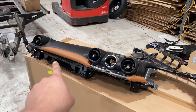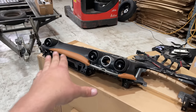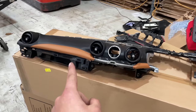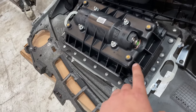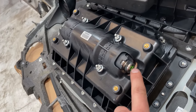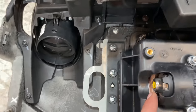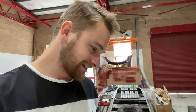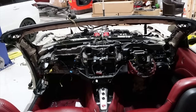You're just going to have to bear with me on the color — that's a job for later. This is looking good, I think we can start to get this in the car now. A quick thought before I do: I'm going to need to keep these airbag leads — yellow and green — because the last thing I want is to put all this dash back in the car, forget an airbag lead, have the airbag light on, and then have to rip it all back out again. So I'm going to go very slowly.